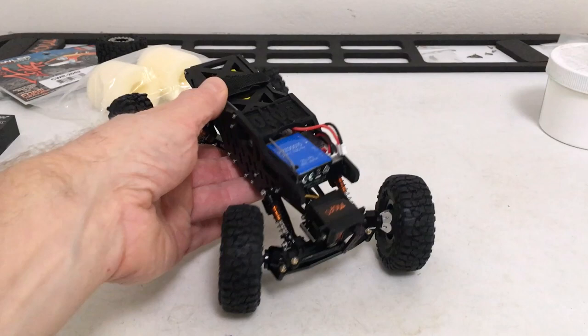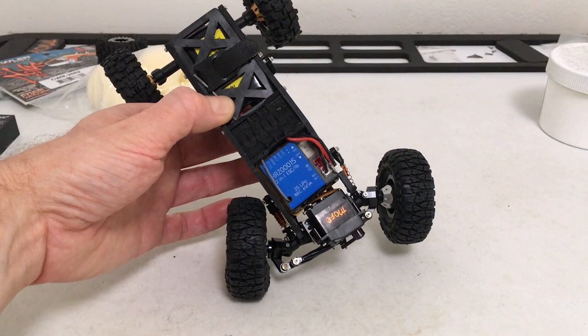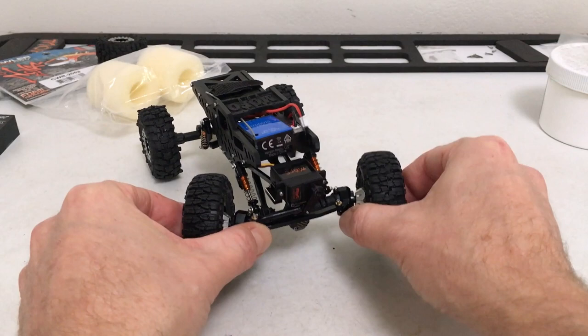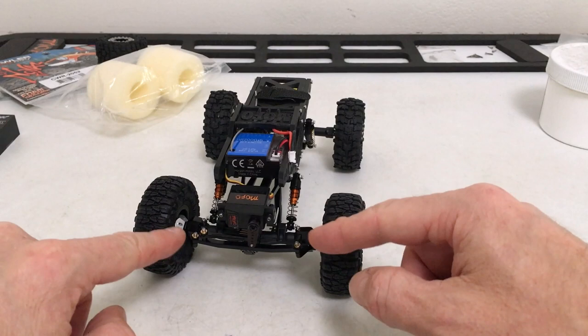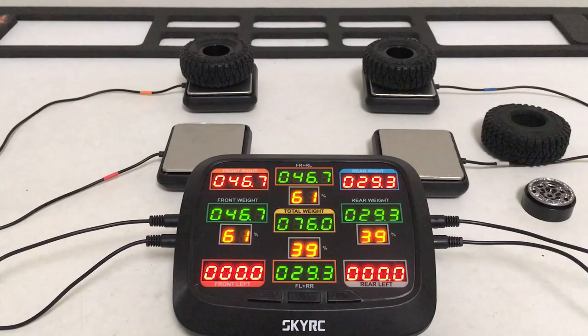I may be able to back off to plus-three if I go with these rims — that basically tucks things in, gives a little better steering because I'm not as wide with the steering scrub. Looks like I'll still need to swap that piece of hardware, but that may be the way to go. I think I'm going to mount up a couple more, maybe swap in brass hubs on the front and all aluminum on the rear, and check the weight.